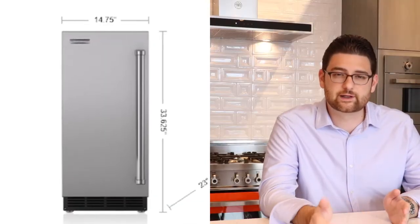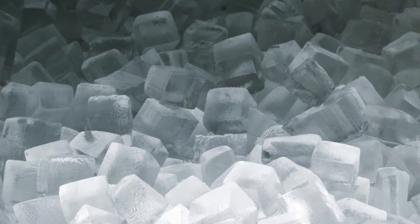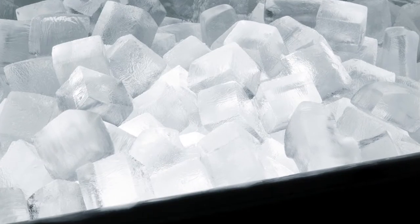When we say clear ice makers, we're usually talking about either a 15-inch wide undercounter or an 18-inch wide undercounter unit for a kitchen, bar area, or outdoor area. These are machines that are constantly making ice. They never stop making ice because as they make ice, the ice drops down into the bin, the oldest ice starts to melt, and there's a pump that usually pumps out any of the melted ice so that it's always dry in there. That's machines by Perlick, Sub-Zero, Hoshizaki, GE, KitchenAid — pretty much anybody calling the ice they make clear ice is using a machine in that function.